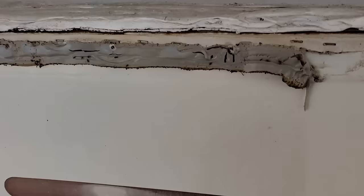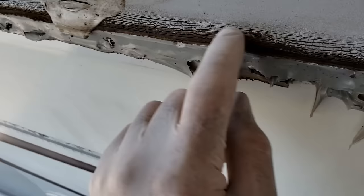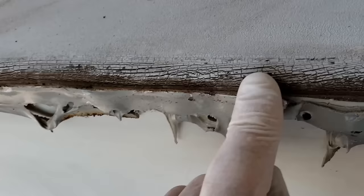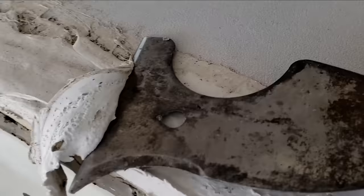This part should be pretty simple — that'll come off pretty easily. The part I'm more worried about is going to be up here. I'll try my best to clean this old stuff off without tearing or pulling up the membrane. No matter what you guys say, you can't use a multi-tool on this. You can see the roof's been tearing — you can actually see where it's been tearing right there. So coating wouldn't solve that whatsoever. Ideally this one needs a new roof, but we're going to coat it to get it a couple more seasons and then the owner can decide what he wants to do. So this is me slowly trying to carefully separate this.